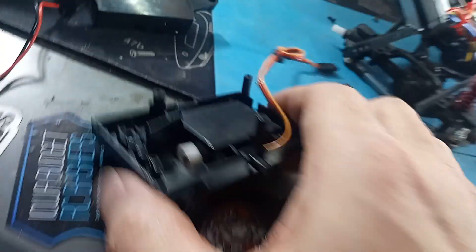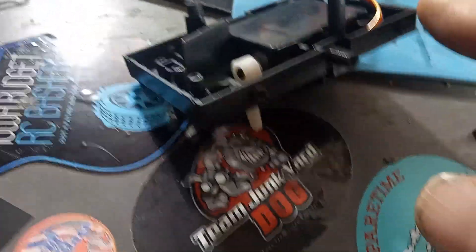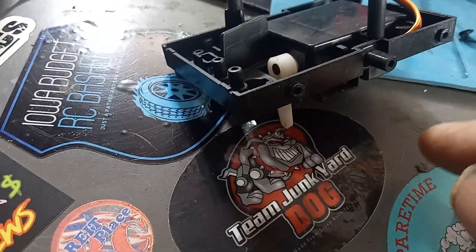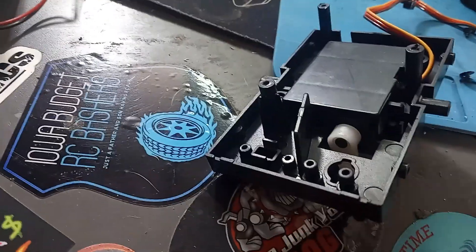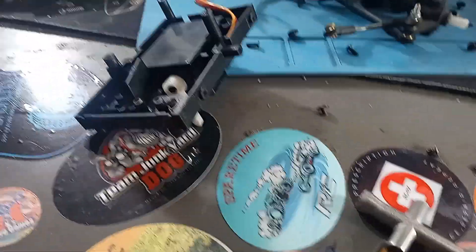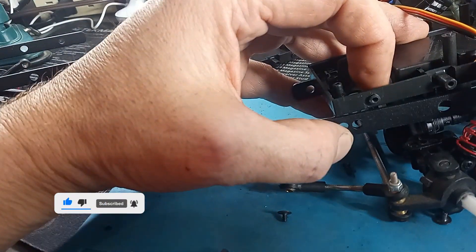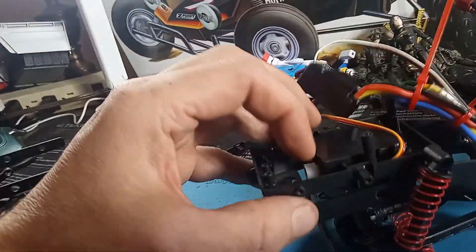I figured out what the easiest thing's gonna be. This one lines up, but the side ones will not. What I'm gonna do is grind these off flush to leave the holes there, drill new holes, and put washers to reinforce them a little bit — make sure they stay together. Maybe put a rod that goes across the front, we'll see. These holes do not line up, so I need to make new holes. Rather than mess with the frame, I'd rather do the plastic piece — that's easier to replace in the end.